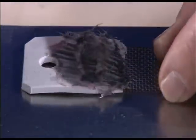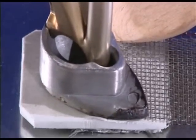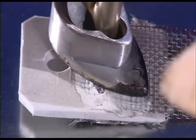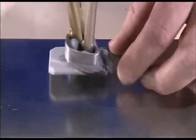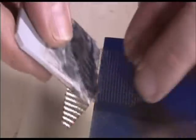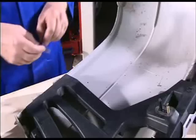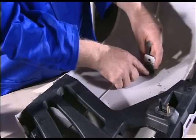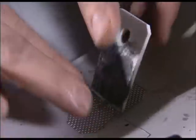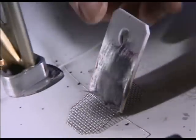Now for the back of the lug. Fold the protruding stainless steel gauze out at right angles. Mount the lug in the required position and weld both sides into the bumper. Tip: bend the lug slightly to the other side — it makes the work easier.